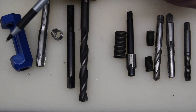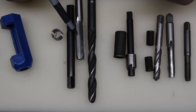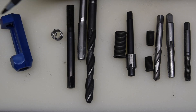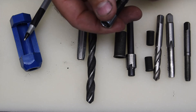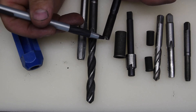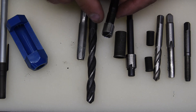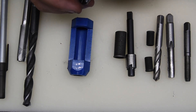The first step is to drill the hole out as straight as you can. The second step is to tap it as usual — make a revolution, then back it off a quarter turn to break the chips built up inside the tap. Once you have it tapped, you use your installation tool to install the coil. On the end of the coil installation tool the thread ends abruptly — there's actually a drive tab on it — so when you screw the coil onto the tool it stops, and that's what drives it into the hole.